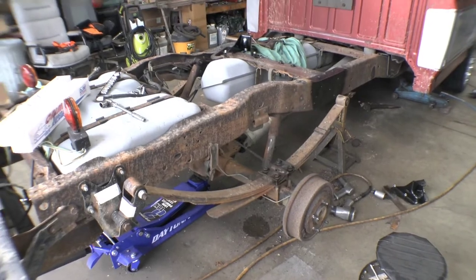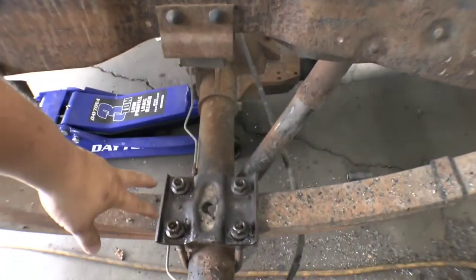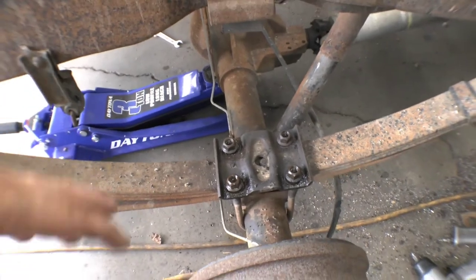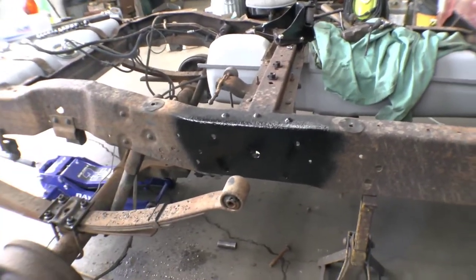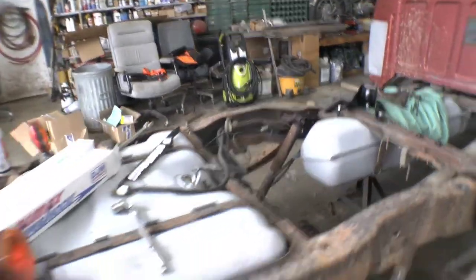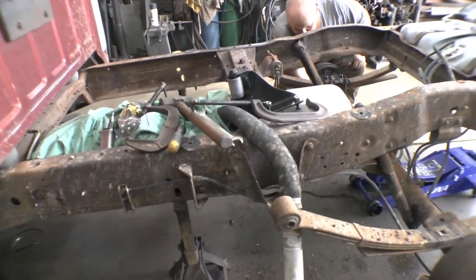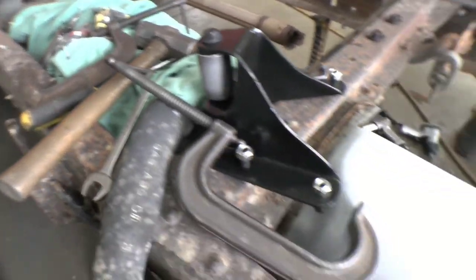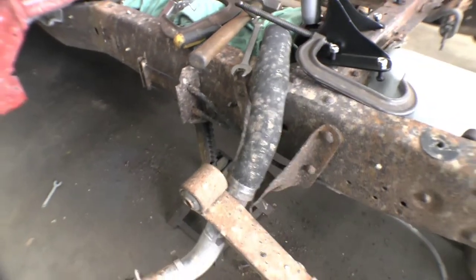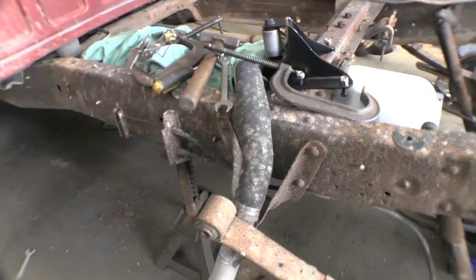Quick update so we can kind of walk through this — we're trying not to bore you guys with a lot of labor. I took these nuts loose and put some PB Blaster on them, so right now the axle is kind of loose from the leaf springs. I took this bracket off on this side and put a little bit of paint on it, and I'm going to put the new bracket on. On this other side, as soon as my drill charges up — and yes, I said drill — I'm going to show you how to remove that side without taking a die grinder to everything, because I've got the welding jacket laid over the gas tank and there is gas there. We don't want to throw sparks, and those are rivets. I'm going to show you a cool trick.